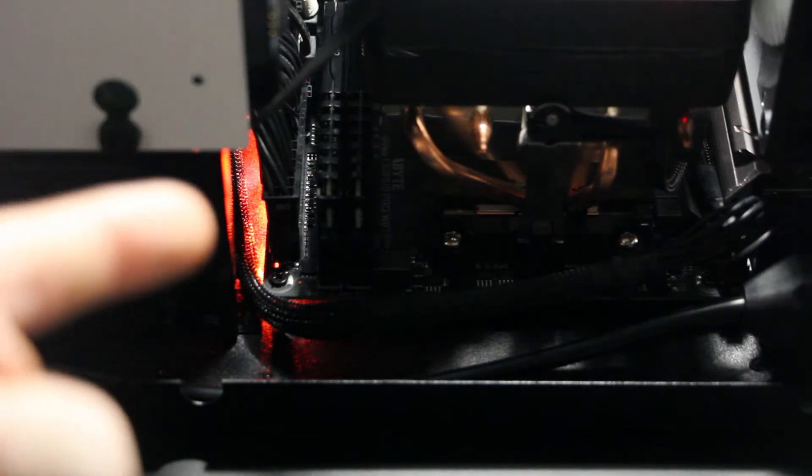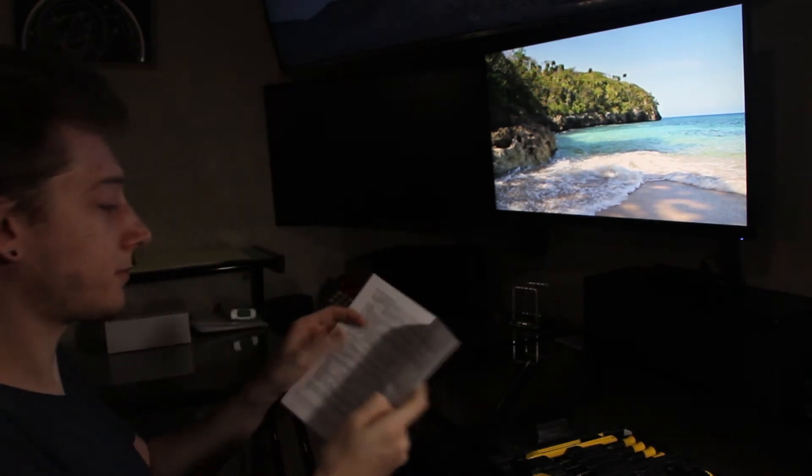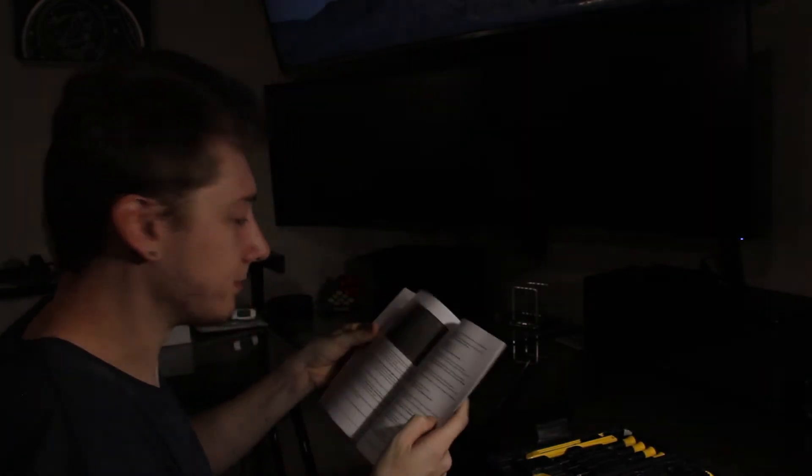So my motherboard has LEDs on it. I usually turn them blue, but right now they're orange — that's default — so we're good to go. For some people there's just going to be a button, you know, just depends. Look at the manual for your motherboard if you really don't know where to find your clear CMOS. I actually had to look at my manual. It's somewhere in there, but anyways, I digress.